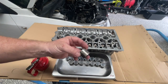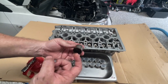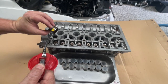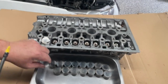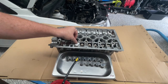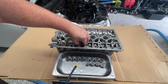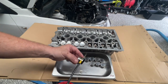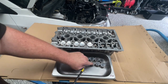When these go back in, make sure that they're clean. There's a little bit of carbon on the inside — that doesn't bother me too much as long as it's not loose. When we put these in, we're going to have plenty of oil on them and just let them drop in almost on their own. You shouldn't need to force them. Sometimes as you put them in they do wedge themselves, so just carefully pull it back out and put it back in again, but it should be little to no pressure and they should just fall into place.